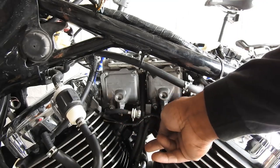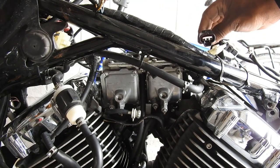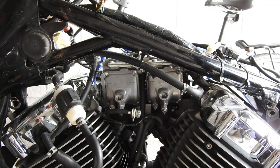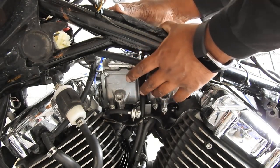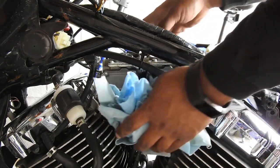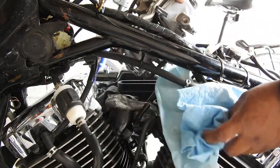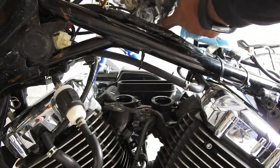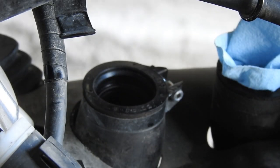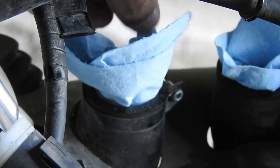With the fuel cut solenoids removed, the two 3mm hose clamps disconnected from the intake manifold, the choke cable disconnected, the thermal switch and throttle position sensor unplugged, the carburetor vent hose and fuel line disconnected, we're now going to pull the carburetor off the intake manifold and rest it on top of the frame. Watch for fuel pouring out. Pull it through the frame and set it on top of the bike, then plug the intake holes with shop rags to keep debris out.